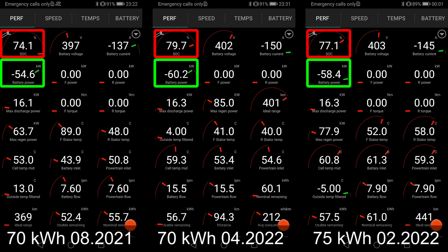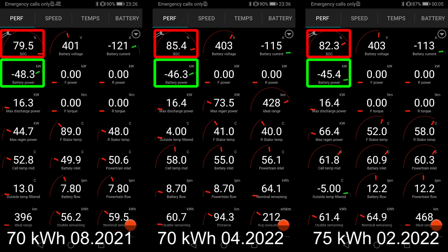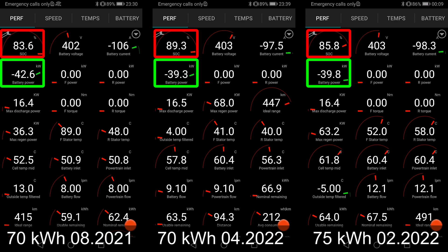This is great news because in the beginning I was kind of disappointed by how slow it was. But you can always ask yourself: how healthy is this? Degradation happens if the battery is exposed to high temperature, which we have here, and also at high state of charge — it's a product of high temperature multiplied by high state of charge, multiplied by the time you spend there. But I guess you don't spend too much time — we're not talking hours and days, just minutes. So you quickly charge up to whatever and then get going. Charging past 90% is not optimal; the closer to 100%, the worse it gets. But you're not going to destroy the battery. If you care about battery health, maybe just charge to 80-90% and charge more often instead.